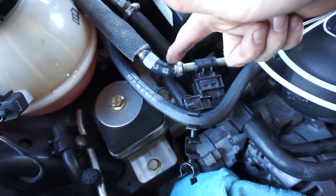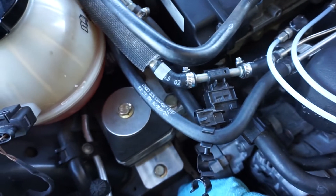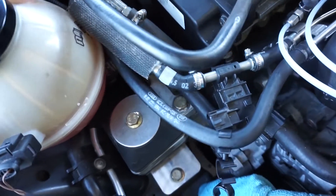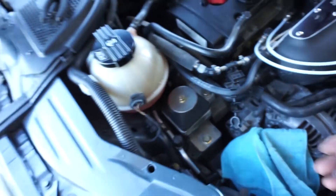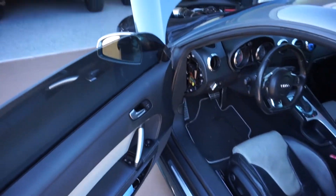Just using hose clamps on the fuel line, cut it there, and now we can get that plugged in and start wiring. This is what our coat hanger is for — we've got to get those wires up there to the ethanol sensor.